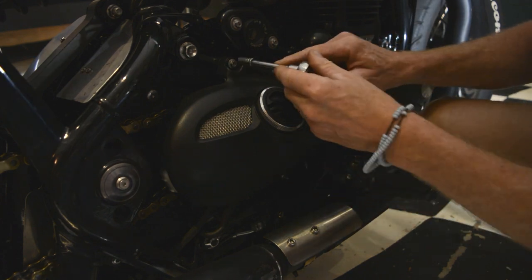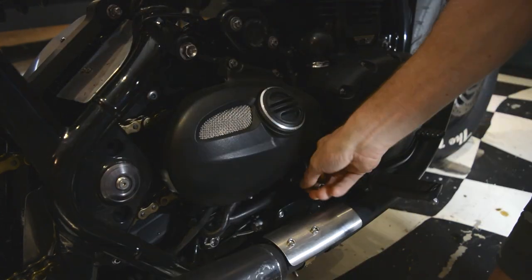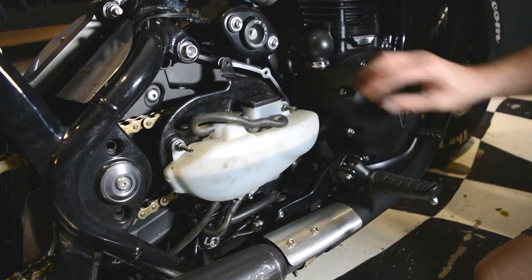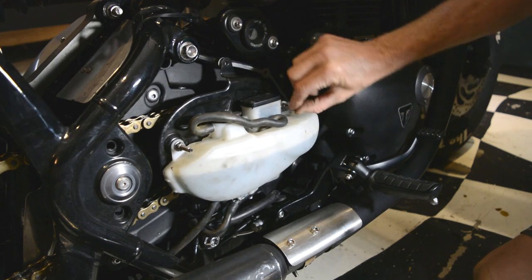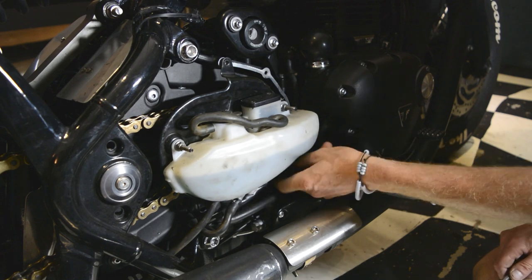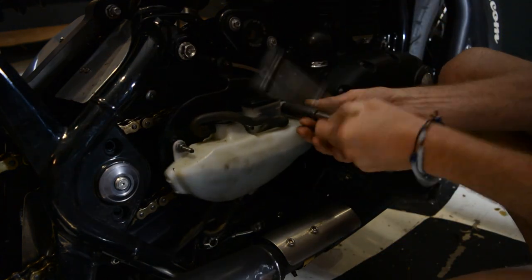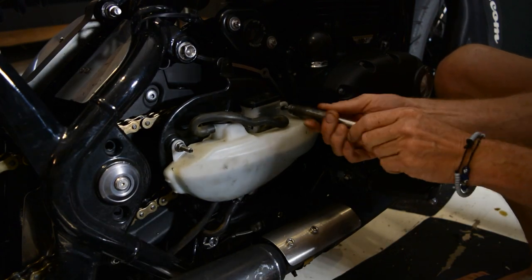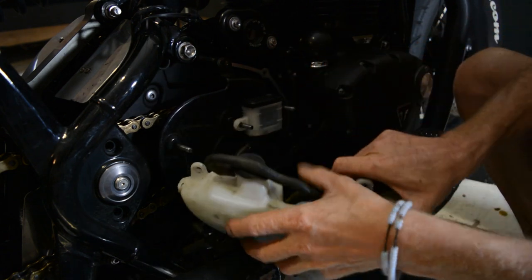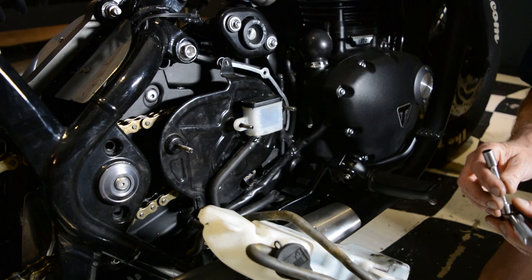The first thing we need to do is get this cover off, which is held on by four 8mm bolts — two at the top, two at the bottom. There's your expansion bottle and you can see the wire. There's another little wire going under there so I can't get enough slack to pull this off. These three nuts need undoing to get the bottle off — they're on the longest studs in the world. Then the expansion bottle should just slide off. The reason I take it off is to get to this little bolt behind here.